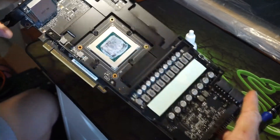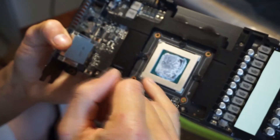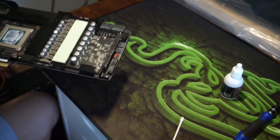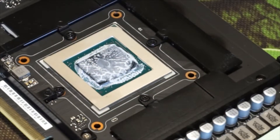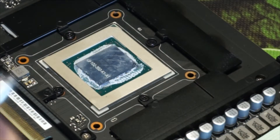The next job is to clean the old thermal paste off the actual die. You need to be very careful because dotted around the die are little surface-mounted transistors or resistors, and you don't want to accidentally knock those off. I'm going to be very careful and clean around the actual die. We've got our alcohol and a couple of cleaning implements — this is a little bit terrifying as I've never done this before. I'm just going to take my time and not rush it.